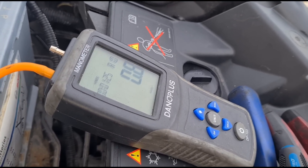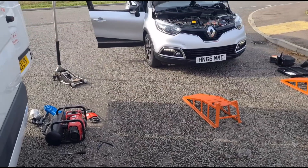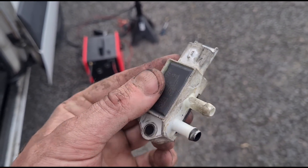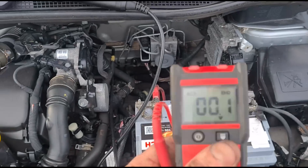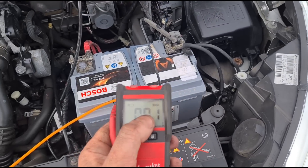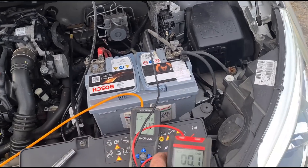The other side is reading between one and two millibars. So pressure within the DPF looks pretty normal. This sensor looks pretty black, and it's clearly not working. It's really difficult to show you because the cable is so short around the back, but we've got five volts supply on the cable and the sensor itself is inert. So we're going to go ahead and get a new sensor.